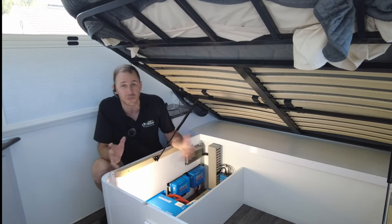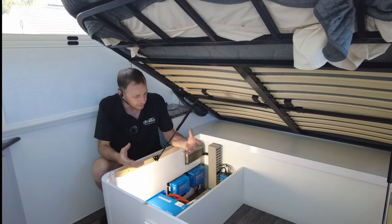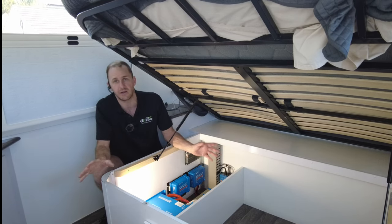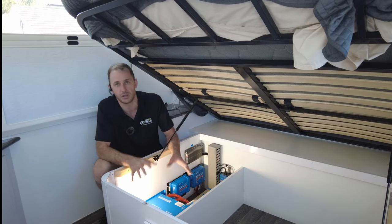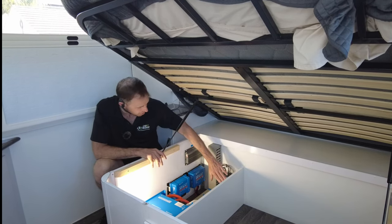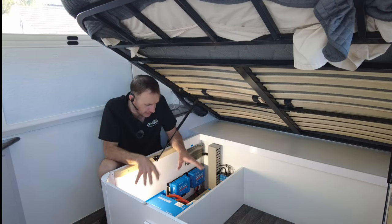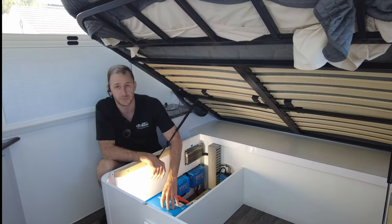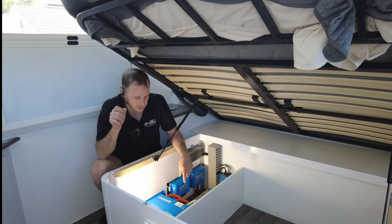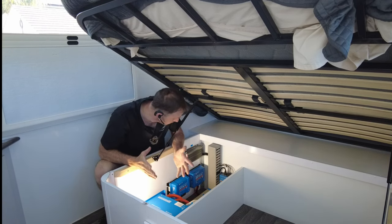You can run your air conditioner when it's stinking hot. Even if you're driving, put the air conditioner on — why not? This is a day and age when you can do this with a good amount of lithium storage, done correctly. These systems are designed for it and, with consumption in mind, customer to customer is different, but this system allows it. All the Victron stuff down here — the Cerbo GX and the Touch 50 — basically a computer system with touchscreen activation. He's able to turn the inverter charger on through all its modes on the touchscreen. I'll get into the new mode that the Multis come with now, which is a really good feature — stick around.